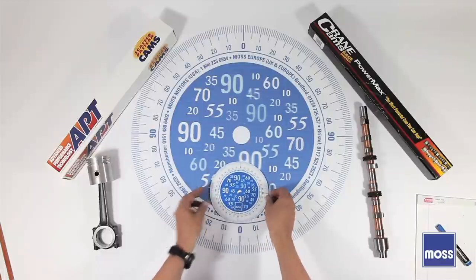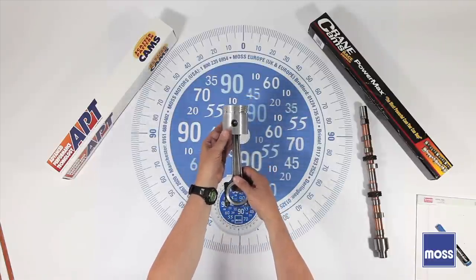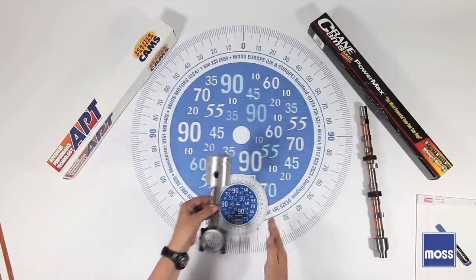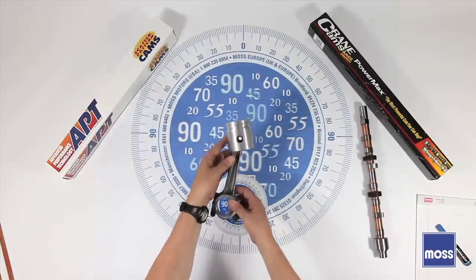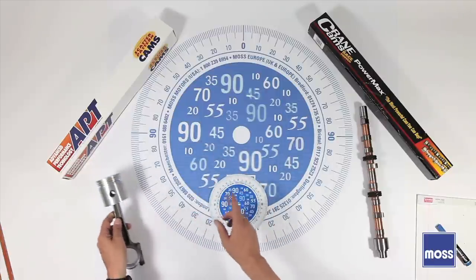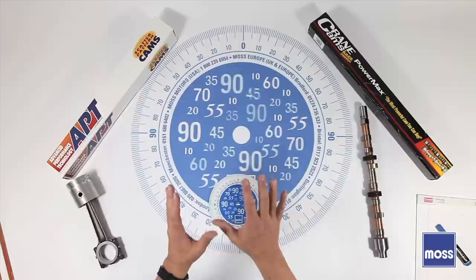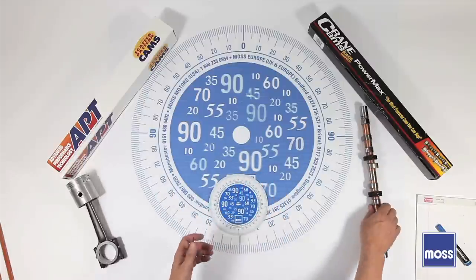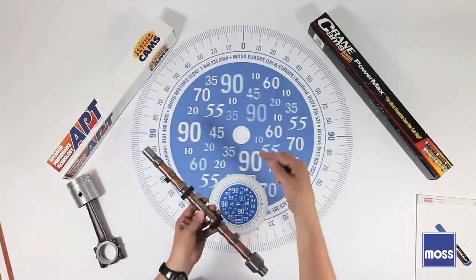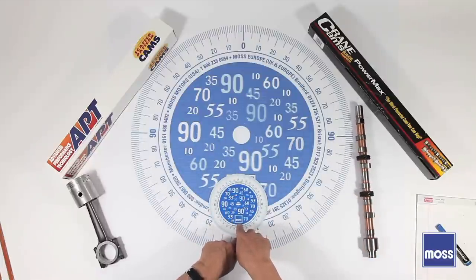Now, what does all that come to? Remember when you were in high school shop class? They told us that the piston would be at its top on the compression and firing stroke. There's an explosion, the piston goes down, the crankshaft goes around, and right about down at the bottom the exhaust valve was going to open. Then the piston would continue traveling up, pushing the exhaust gases out, and somewhere by the top she would close off the exhaust valve. We're going to find in a moment that while that's nominally accurate, it's not accurate enough. Inside these engines is a very dynamic series of events. A camshaft can't wait for something to happen to go on to the next thing — these have to be proactive. In our next video, we're going to find out that we don't open the exhaust valve down there at all, and we're going to find out why.